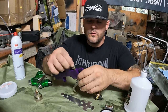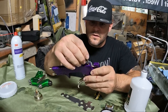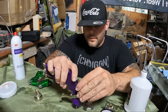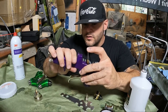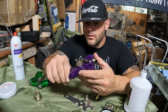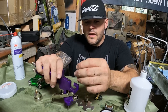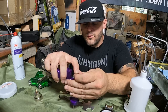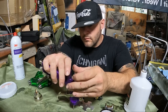We're going to take this back piece apart, which is the part that takes off the needle, which feeds the material into the gun. This pushes out, then there's the spring. It is a brand new gun, but there is an astronomical amount of oil in this gun — not good. You would really have to clean it extremely well, because if not, your parts are going to come out like crap. Oil and paint does not mix.